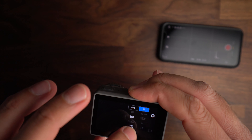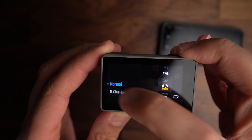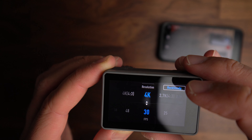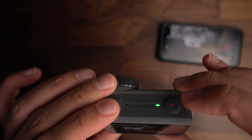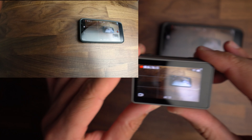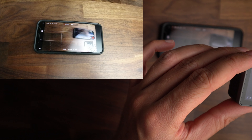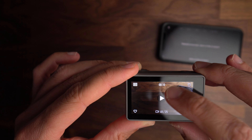If we swipe left on the back screen, we have access to some more advanced settings for manual exposure, custom white balance, color, and de-warp on or off. De-warp is great — it removes that super fisheye look. Swiping up from the bottom allows us to change the resolution and frames per second, as well as RockSteady on or off. Blue means RockSteady is enabled; white means it's disabled. Here's a super quick test with RockSteady off, and here with RockSteady on. In future videos, I will do an in-depth analysis of this, so be sure to subscribe. Swiping from the left allows you to look at previously recorded files.